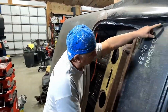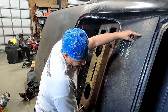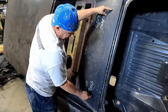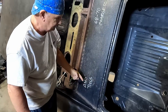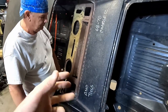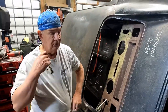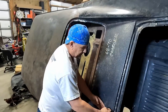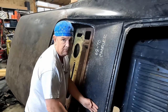Because it doesn't go all the way to the outer edge. If it's like this, according to the picture he sent me, that's about your shelf that we've used. And just have an L to where it comes up. And then we'll have it up a couple inches, so we've got something to screw through to bond. Yes, both bond and screw. Gotcha. We'll be screwing the fiberglass to the metal, because when it grabs the metal, it'll suck that fiberglass too.